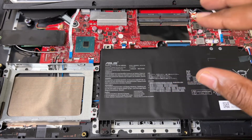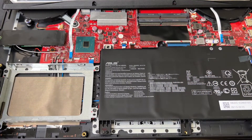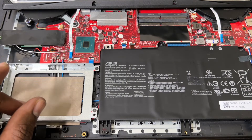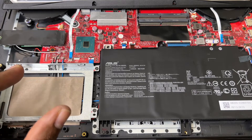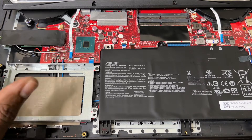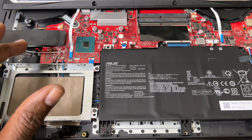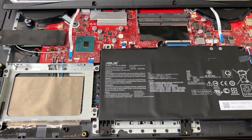This particular laptop has two RAM slots and the maximum RAM you can put inside is 32GB. For the SATA slot I'm not sure — maybe up to two or four terabytes — I only got a 500GB one. For the NVMe SSD I think you can go up to one terabyte and it's a gen 3, not gen 4.